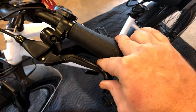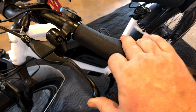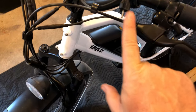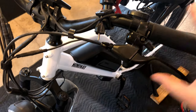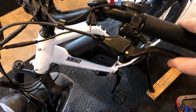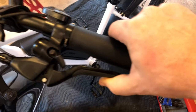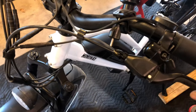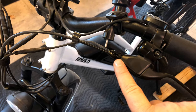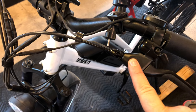I like to have about a finger width when you pull the brake back — that puts us in a real good position. If you need to make fine tune adjustments, just loosen up the barrel connector here, back it out a little bit, and keep testing where you want that brake lever to sit. I'll adjust that out after we're finished with all the brake adjustments.